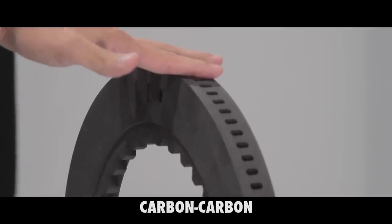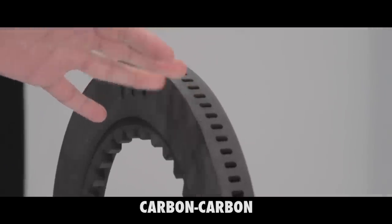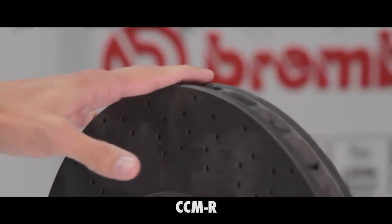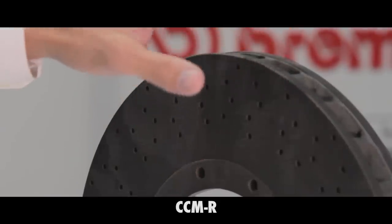The carbon-carbon disc operates with a brake pad made of almost exactly the same material. It starts as a laminated construction, then temperature and pressure convert the matrix into carbon as well. The CCM racing disc takes it a further step with the ceramic process applied. It must be 100% machined to shape, whereas the OE version is molded — making this disc's manufacturing process months long rather than the shorter OE process. This gives a material with much higher strength and better longevity at high temperatures.